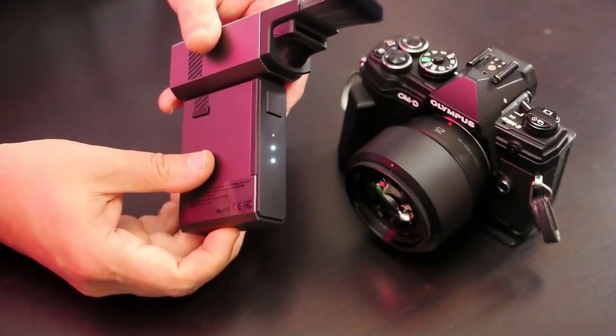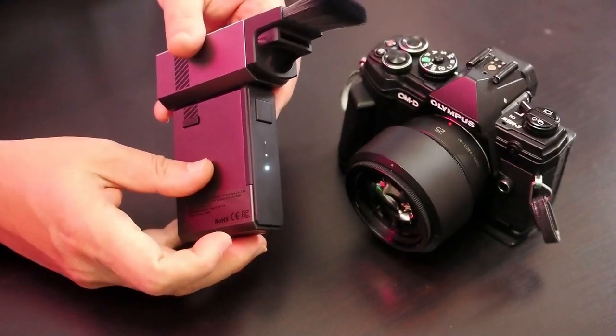You can push the power button again to go to medium power, or to low power when there's a single LED. By default, the blower will stay on as long as you hold the trigger button down, and when you let go, it stops. It also has an automatic mode where you tap the trigger button and the blower stays on until you tap it again. To activate that, press and hold the trigger button and the power button for one second. To go back to on-demand mode, push and hold the trigger button then the power button for one second.